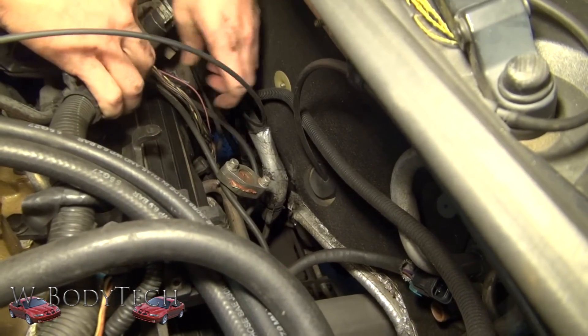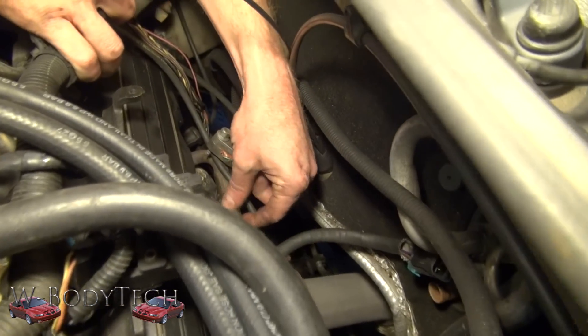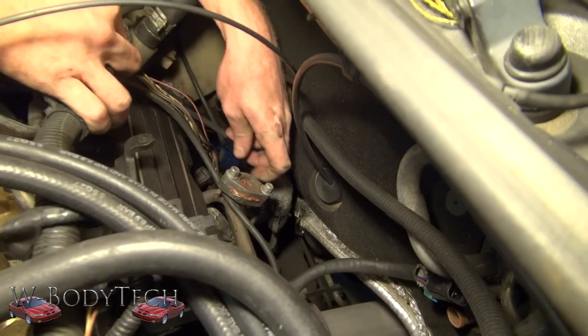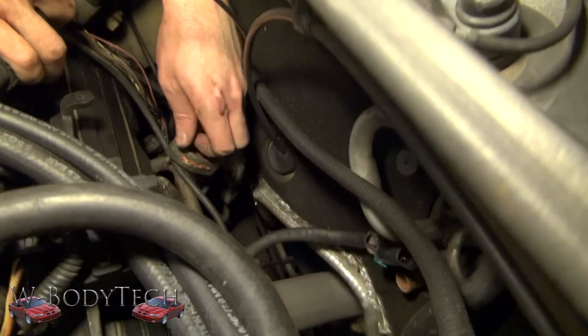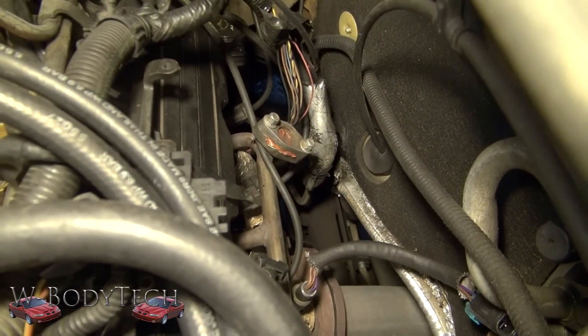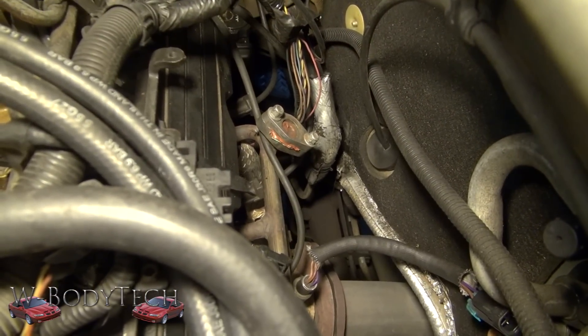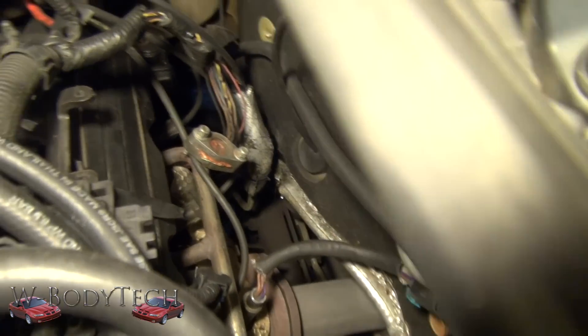As you can see, my rear manifold is equipped with California emissions — beautiful, and a pain in the ass. This port is blocked off; I deleted all the California emissions, but these tubes fill up with carbon if California emissions is not equipped. That manifold is going to go, and the new headers will not have any of that.